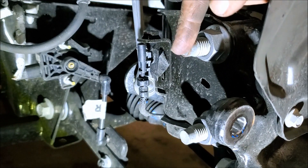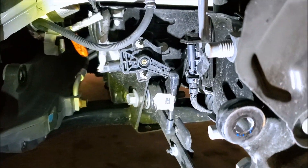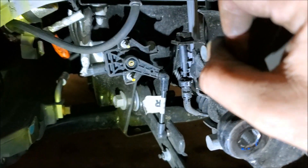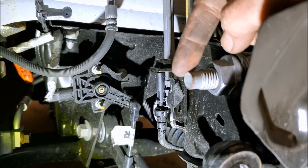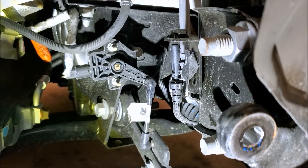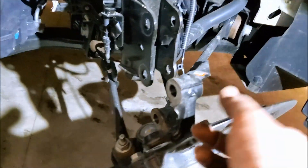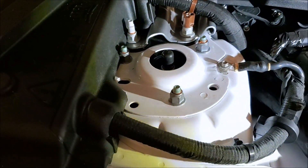Now the most painful part of the job — the two spindle bolts, which are 21mm and pressed in. You need a sledgehammer to drive them out. A good trick: turn your wheel so the bolts face outward a bit for a better swing without risk of hitting the car. Before swinging, thread the nut back on to the end of the bolt — this prevents mushrooming the end so you can get the nut back on later. Then beat the crap out of it until it lets go. Once out, that whole assembly just drops down.